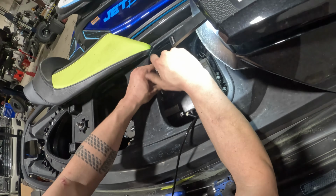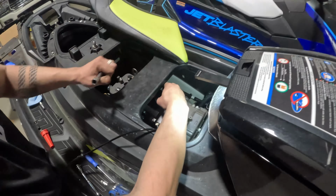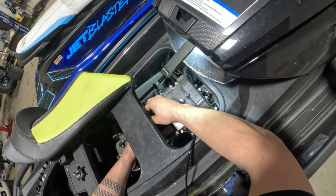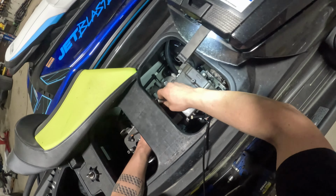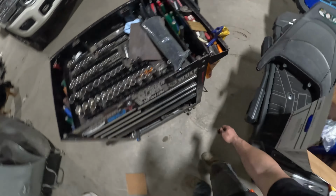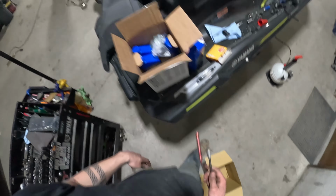And just look at that hose, make sure it's still draining there. You'll notice when it starts coming to an end, because there will be a lot of bubbles and very little fluid, that's when you typically want to make your last adjustment. Push that hose just a little bit farther down in there, just make sure you can get as much of that oil out as possible.